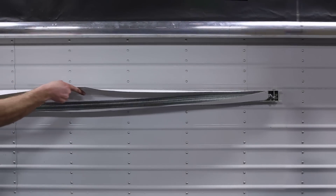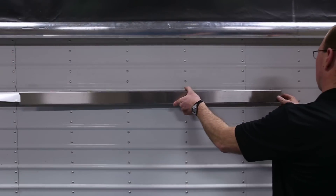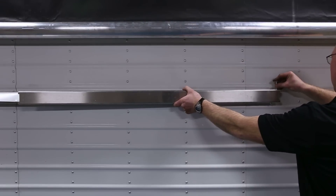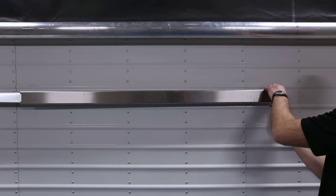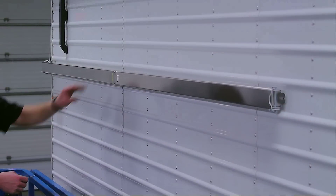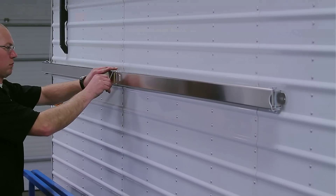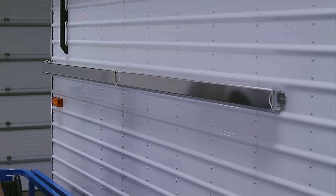Step 16. Slide the wear tube around the spring and driveline assembly in the spring box. Align the holes in the untabbed door with the holes at the end of the spring box and insert a 5/16-inch by 3-inch bolt. Then tighten with a lock nut, snug tight only. Repeat for the tab door at the other end. Swing the doors closed, with the tab door overlapping the opposite door. Then insert keeper pin. Repeat steps 12 to 16 for the other end of the trailer.